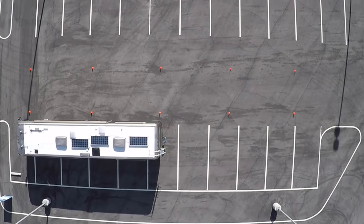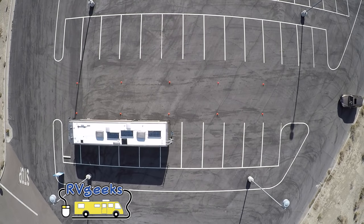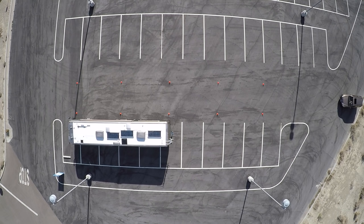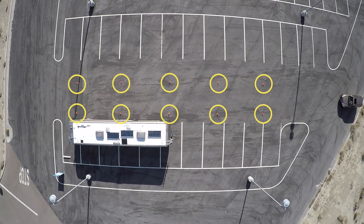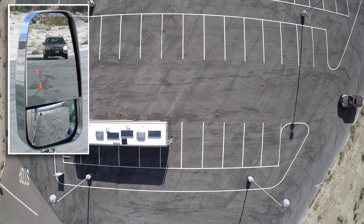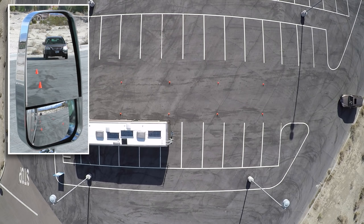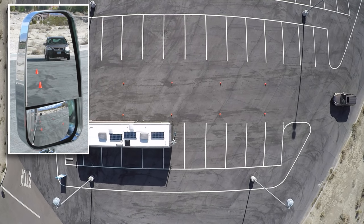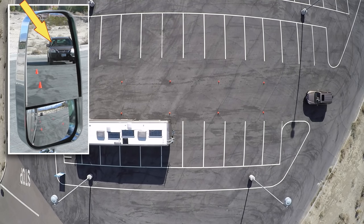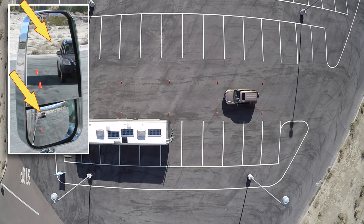Let's look at a more vivid demonstration of what each mirror sees. We've launched our solo quadcopter to give us a bird's eye view of a parking lot where we've marked out a standard 12-foot wide lane with small traffic cones alongside our RV. Our car will slowly pass us on the right-hand side as we monitor its progress in our mirrors. Before we roll the car, notice that at about two RV lengths behind us, it's clearly visible in the flat mirror, but only a tiny, barely visible speck in the convex. As the car approaches from behind, notice how it starts to leave the flat mirror as it begins to exit the narrow field of view, while gradually becoming larger and more visible in the convex mirror.